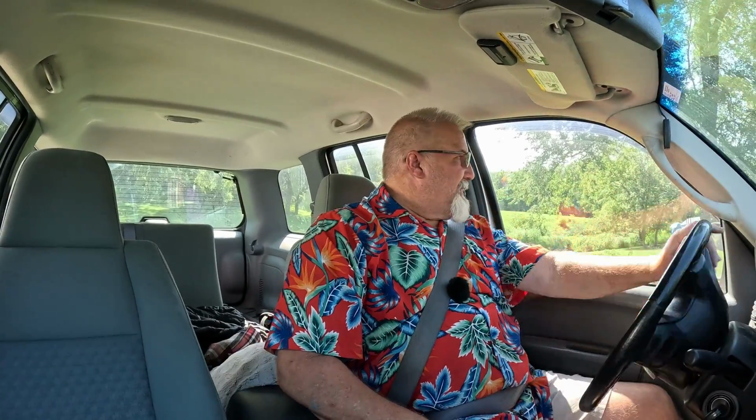Now, one thing I will do, just because these are new parts doesn't mean they're all created equal. I think everybody's had experience where they've had brand new parts, if you worked on anything for any length of time. Because sometimes the brand new parts can fail. And it may be 1, it may be 2, maybe none. I'd love to see us get 164 more thousand miles on this set of plugs, or set of coils and plugs. Actually, I think the plugs you change, these iridiums, typically every 100,000 miles. On my Impala, I changed them at 124,000 just because it didn't give me any issues. And when it came time to do some other work to it, when I did the transmission, it's like, let's get that taken care of.